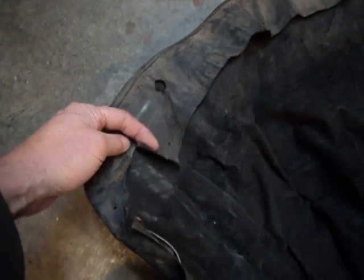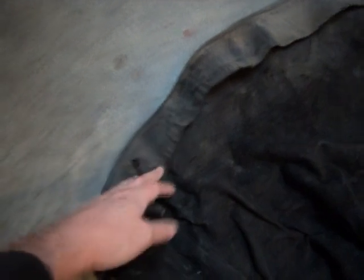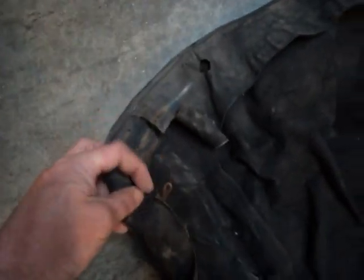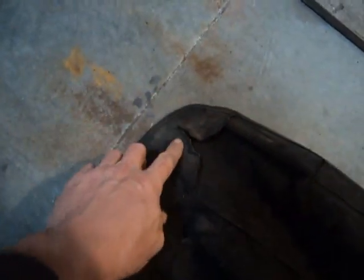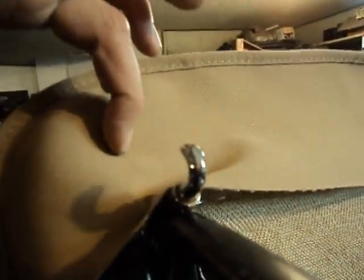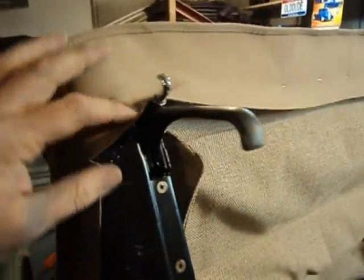We're going to take a look at our stock top for just a second — it has a couple of rips but you can see the front bow pocket right here. It's clearanced and trimmed — one side is actually cut properly, about an inch from the end of the pocket right in front of where our latch goes, then clearanced around there in a semicircular fashion to let the top latch come through. What that means is we need to cut this in here and make accommodations for our latch, just a little cut around there to give us room to move.